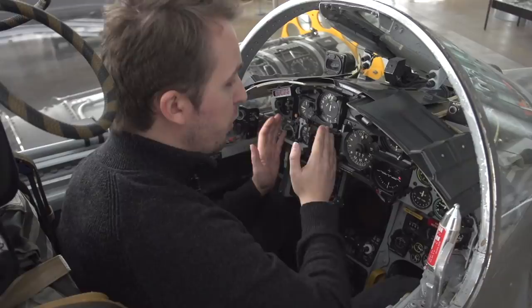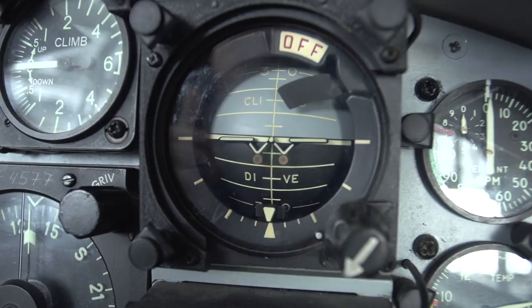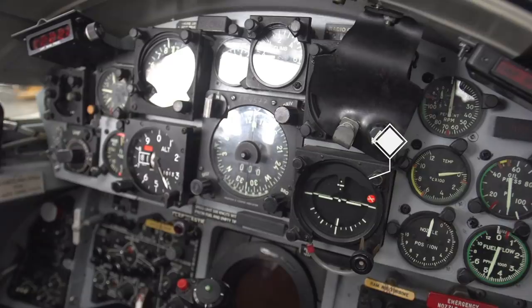Moving into the middle here, we've got the basic six plus a couple of extra dials in between. The artificial horizon is to the top right — this can be hidden with a rubber cover. Below that you will find a standby attitude indicator, and the prominent dial in the middle is the PHI position and homing indicator. Above it you will find the rate of climb indicator as well as an angle of attack indicator. An integrated speed and Mach counter is found to the left with a pressure altimeter below this. An accelerometer is then found above the radio altimeter, and all the way on the left the radio frequency selector linked to an additional display, as well as a turn and slip indicator.